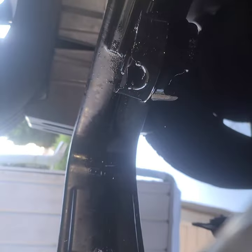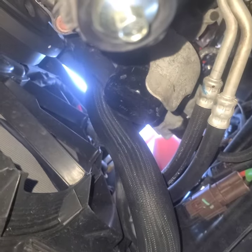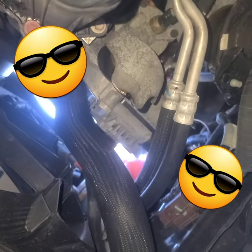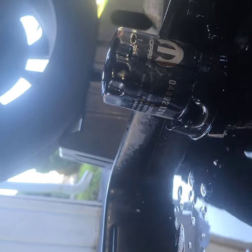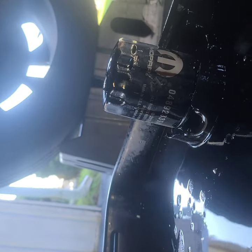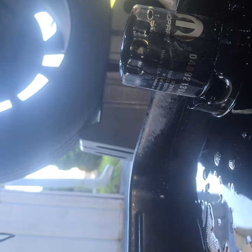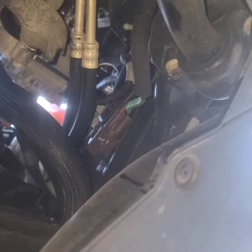Have your oil catch pan ready. I got lucky and muscled it out — there it is, the old one. Unscrew a little bit first, let it drip until it stops, then keep going. Unscrew a little more, let it drip some more, and eventually just yank the whole thing out. It might make a mess, but that's okay.